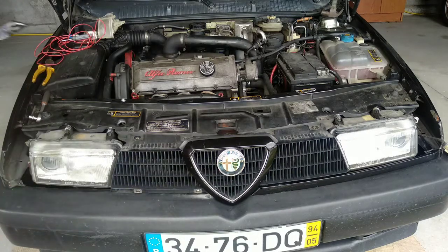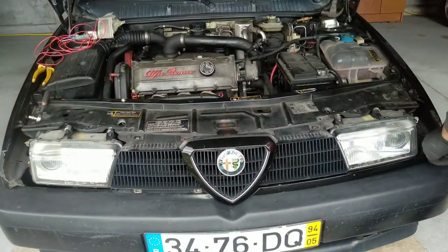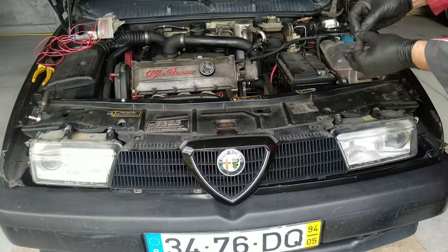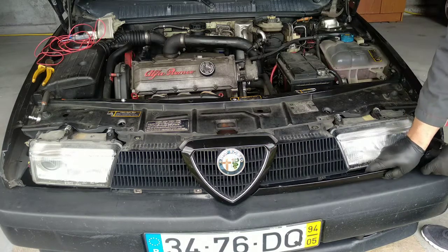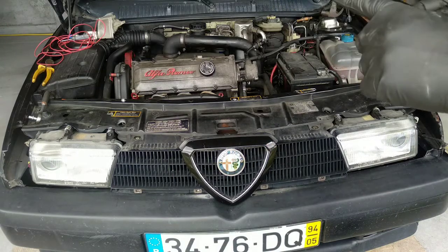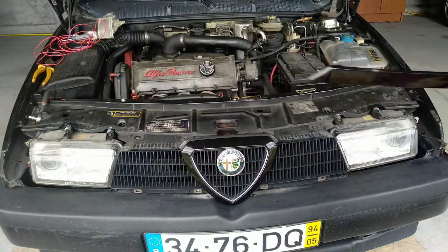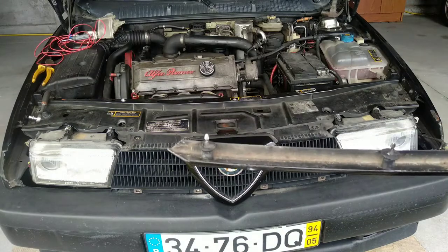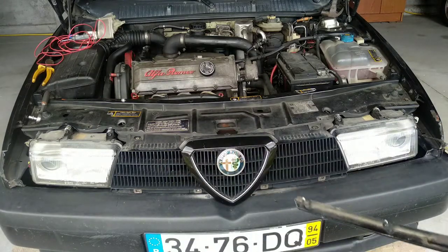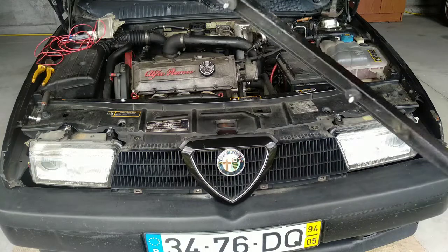Now in this way you can take out these parts very easily — they are just pushed in place. Another washer and nut. Try not to break anything. I put some grease on here to make it easy to take in and out. Attention: do not use oil-based grease, because there is plastic here and you will damage these plastics.